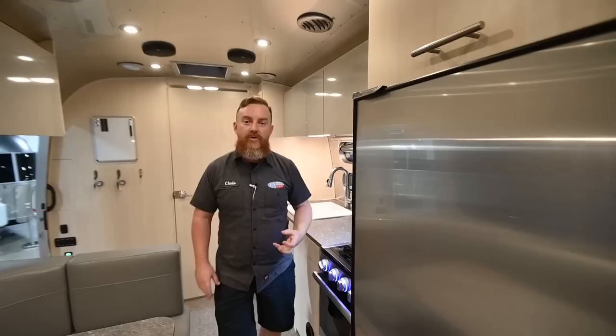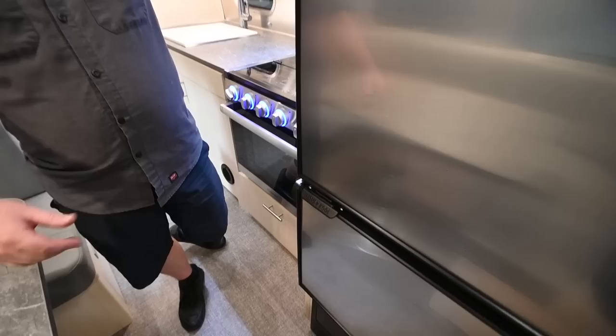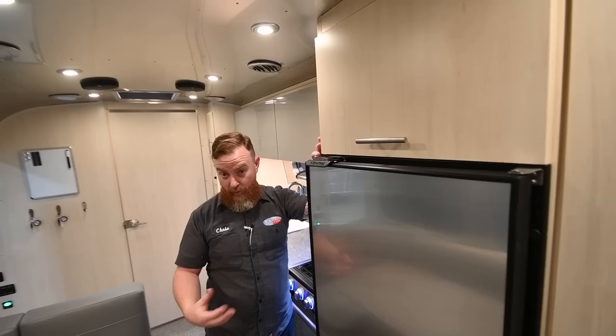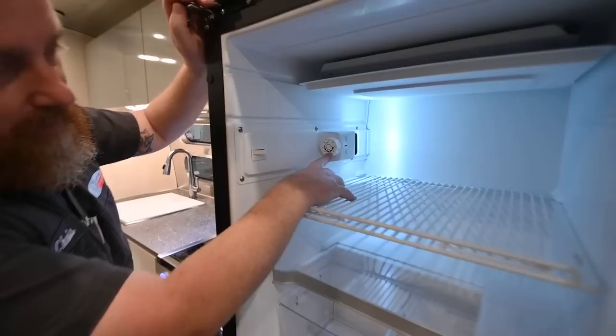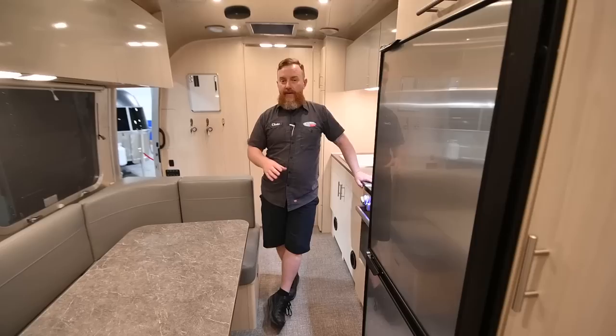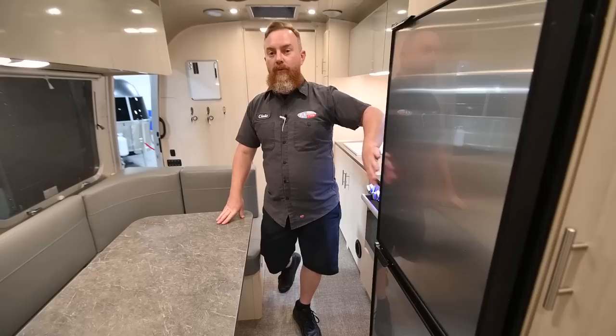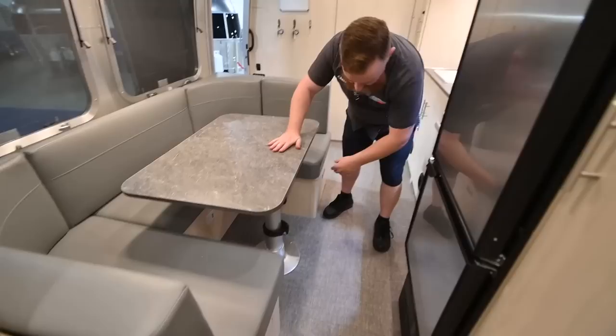Next, we've got the refrigerator. The refrigerator in this unit is an AC-DC refrigerator — plugged into shore power, it runs off AC; pull the shore cord and it automatically switches over to DC from the battery. You don't have to do anything to make that happen. This refrigerator has a travel tab on the refrigerator door and on the freezer door to keep them shut while towing. These tabs can also be actuated when storing it to prop the door open so it doesn't mold or mildew. Inside, there's one temperature knob that operates both units — seven is the coldest and one is the warmest. This refrigerator takes two or three hours to get completely cold, so I recommend plugging it in and getting it cold overnight. Completely packed full of cold food, it will stay cold without external power for five or six hours. Because it runs off the batteries and the tow vehicle charges the house batteries as you tow, if you leave the master disconnect switch on, you will power the refrigerator all the way until you reach your camping site.